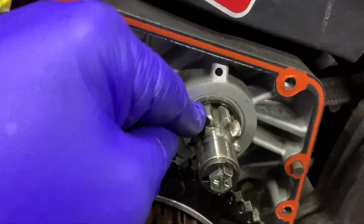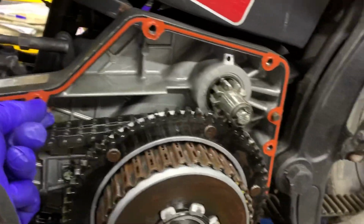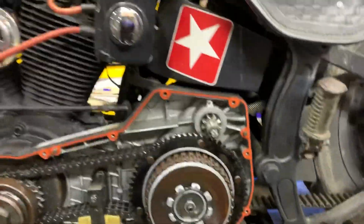Okay, as you can see, the jack shaft, not bad, not a bad bike at all, really. Obviously someone's used a load of sealant to reuse all the gaskets. They haven't changed them last time they did it. There was a bit of leakage coming out, a bit of leakage on the primary as well, on the inner primary, which most likely means your gearbox seals are gone.